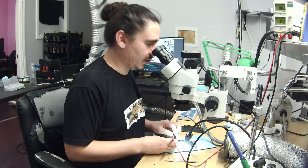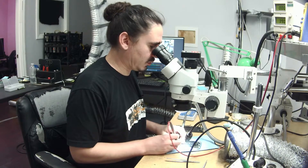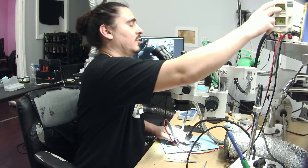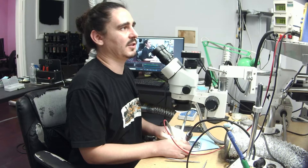When I do that, we can see basically nothing. I'll plug my probes to the battery connector and press the power button — I get no amp draw whatsoever when I prompt it to boot. There it goes, it gave me a little bit, it's trying at least. If I hold it, nothing. If I just press it, a little spike.